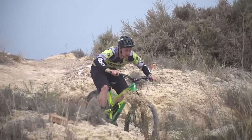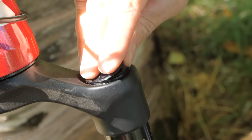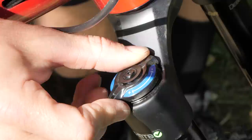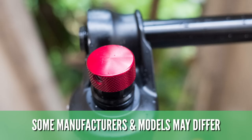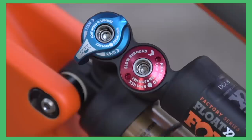This particular fork is a RockShox fork. On the left-hand leg, that is where the air spring is housed. There's a cap on the top, and underneath is a valve. To operate this, you need to have a shock pump. On the right-hand leg, you have your damping. Always on the bottom is the rebound, which has a red dial — it's the same across many brands. On the top is your compression adjustment, which has a blue dial. Blue for compression, red for rebound — that's pretty universal on most bike brands.